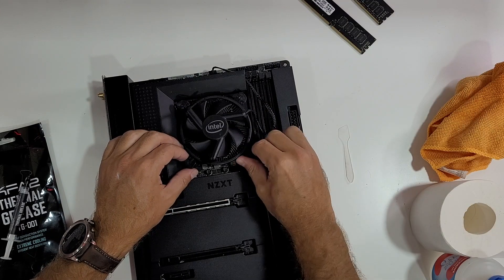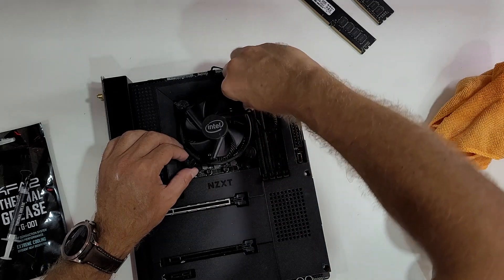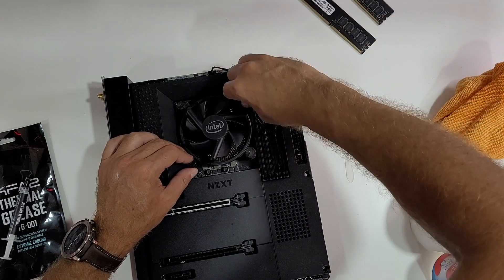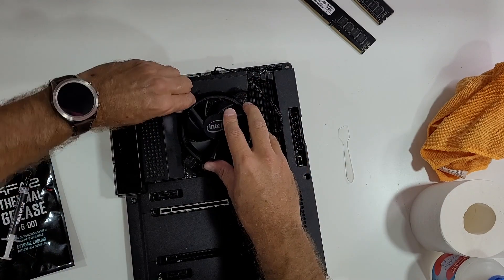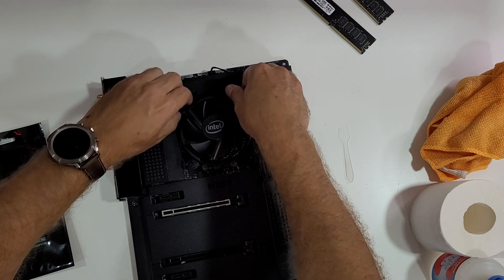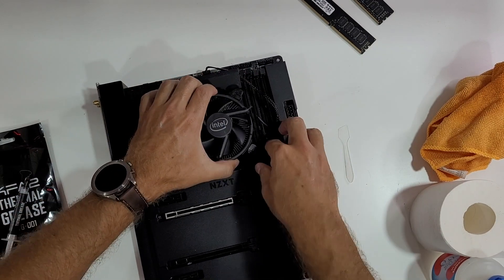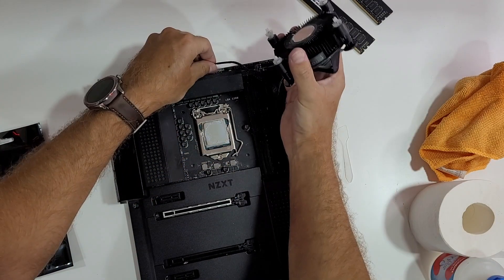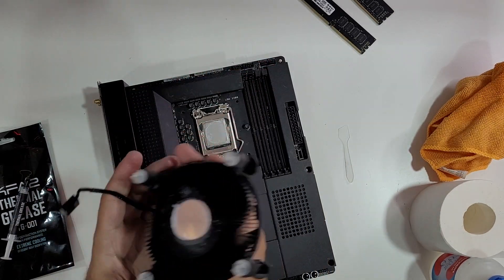This is the factory CPU cooler. I'm just going to rotate these — not screws, but these plastic thingies — rotate here, here, and on this one as well. Once I rotate, I can lift it up and remove the cooler from its position. Now just remove the cable — sometimes we don't need to remove the cable, but in this particular case to show you, here we go.